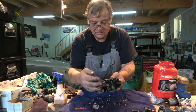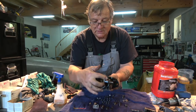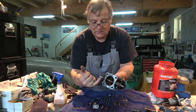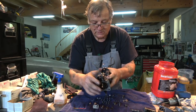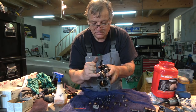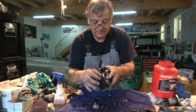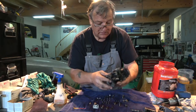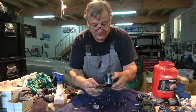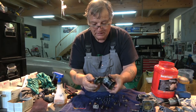What I'll have to do is drill this brass inside here where the stop is. There's a brass pin, and I'll drill that out, take this out, because I have to replace the pin and cork. It comes with a spring, a copper top, and a cork gasket which fits over the shaft, and it stops air being sucked in the side. I'll show you that when I come to it, but that'll be a while away. This unfortunately had a broken stem in it. These things are 106 pounds on their own, this fuel bowl. And this is a common problem.